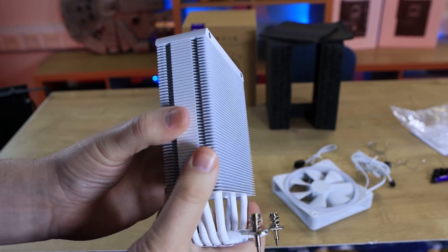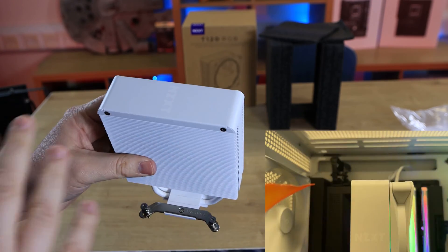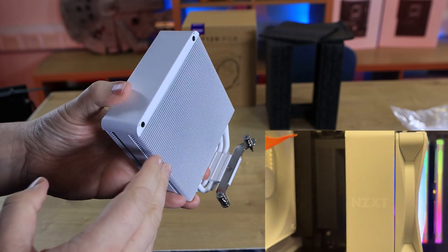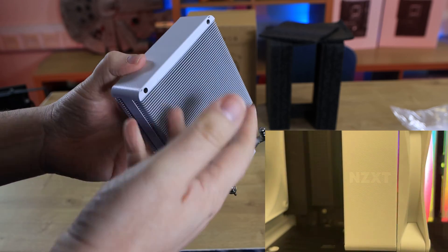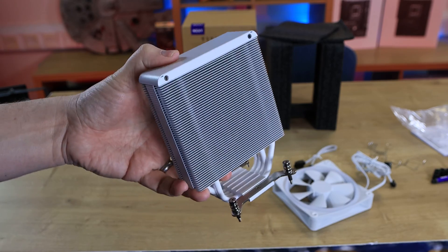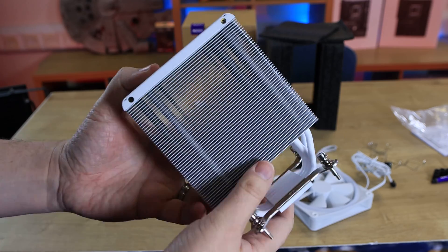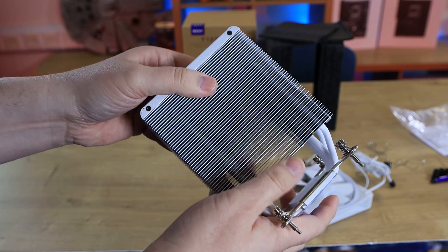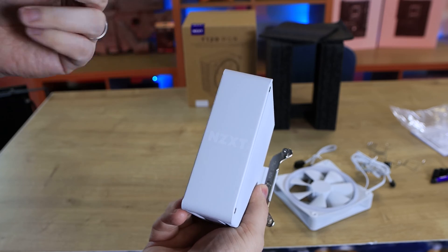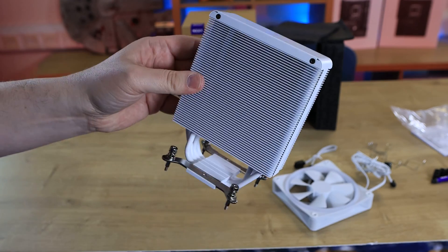This is the heatsink part itself. There is no cabling or anything on the heatsink because there's no RGB lighting on it — all the lighting is done just on the fan. To me that's a cheap way of doing an RGB product: you basically take something that isn't RGB, stick an RGB fan on it, and call it RGB. It would have been nicer to have the logo light up in RGB. But it looks alright — it's white, and you can see through the fins quite easily, so it's not the densest fin stack. It's one-piece metal on top, not plastic, which is good since plastic can affect airflow and heat dissipation.